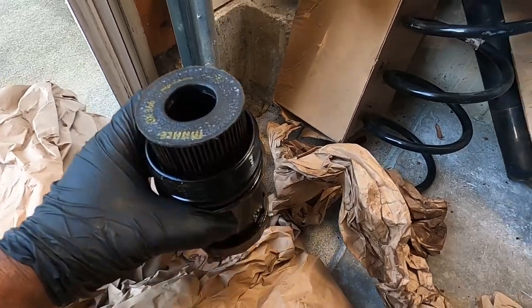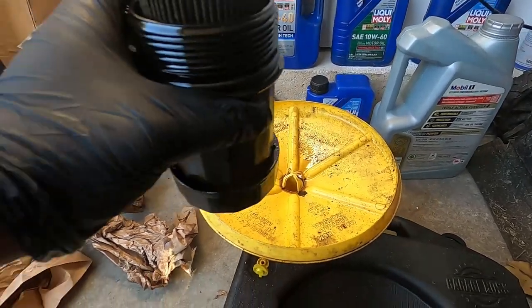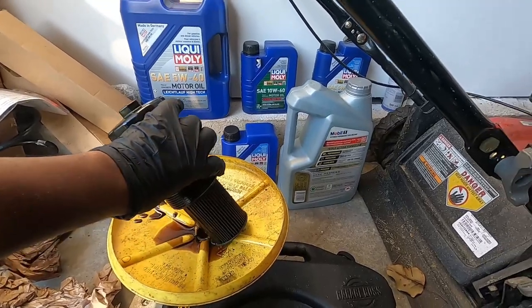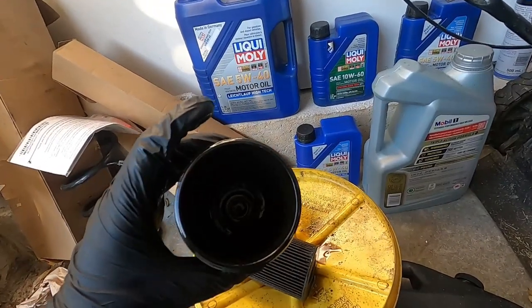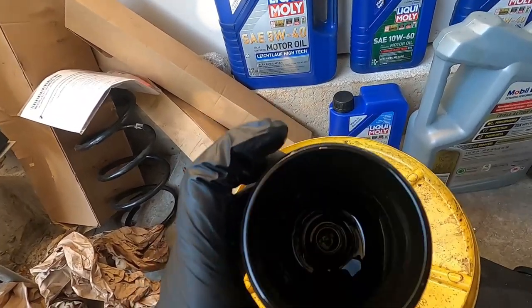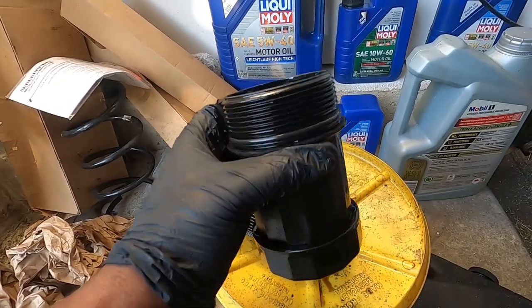This is the filter. I went ahead and torqued everything back under there with the new drain plug and crush washer to 37 foot pounds of torque. I removed this filter and now I'm simply going to dump all the oil that was inside the filter and remove the old filter element. Now what we have to do is clean up the inside a little bit, remove the old gasket, replace it with a new one, then install the new filter, add a little bit of oil, and mount everything back in the car. We are also going to torque this one — the torque spec is 17 foot pounds.